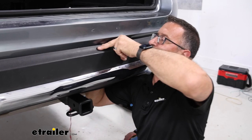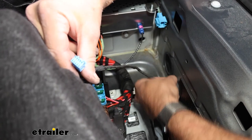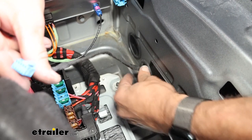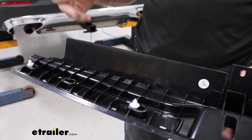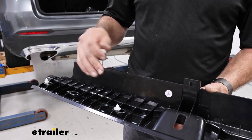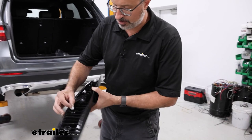Now we can run this electrical line back up. Pull the whole wire through and to reset the grommet you need to pull it all the way through so you can fit the inside, making sure that's sealed in and not leaking anything. Then hook the connector back up inside. One other thing I wanted to mention: when you're pulling out this rear scuff plate, the clips need to stay with your scuff plate and not in the vehicle. Chances are these clips are going to break — these are like one-time use clips. If you get some out and they go back into your scuff plate, great; if they don't, we have these available in an entire kit here with other fasteners. You may be able to source these independently online or at another retail store.